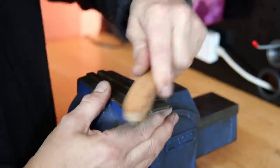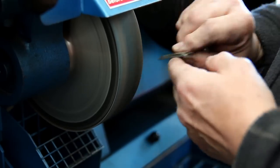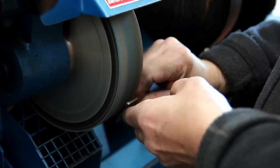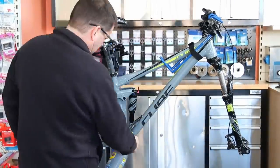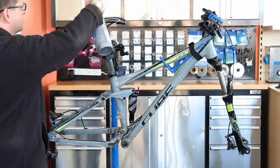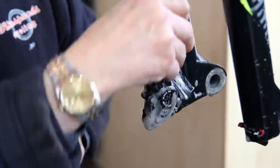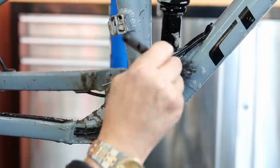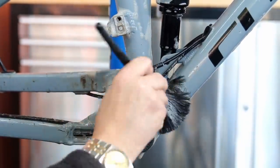Next up we do the brake pads. My process is: one, clean up all the debris on the pad; two, skim the pad - that just takes any little grooves that are forming or any oils or ingress in the pad, and makes them as good as when they came out of the packet - a nice smooth brake pad. Then we actually sand down the disc itself, which will stop any squealing.